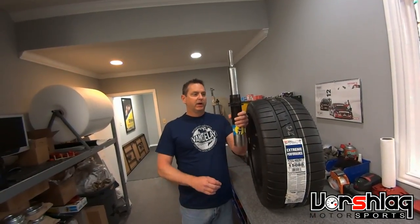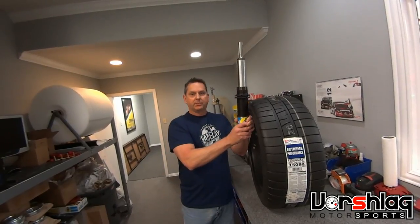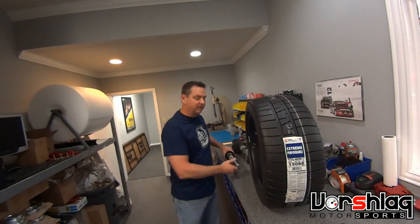To get a big tire on the front of the 6th gen, you're going to have to go to a coilover, and then we're going to have to get the lower perch above the top of the tire. We can do that, and we've done that on countless other cars, but it's very unusual the way they set this up with a really long spring, which you'll see later in the video. And that's the reason why there's a skinny tire on the front of the 6th gen.